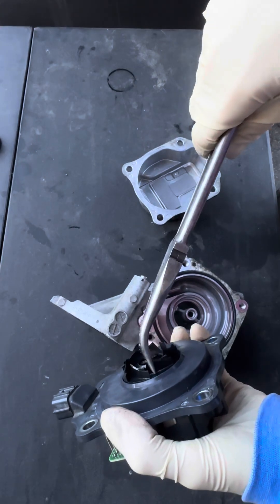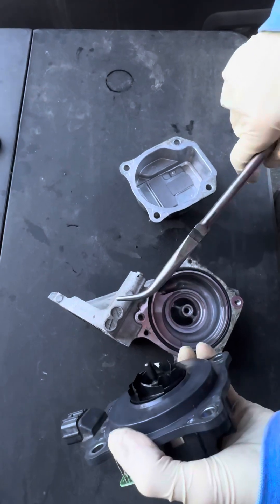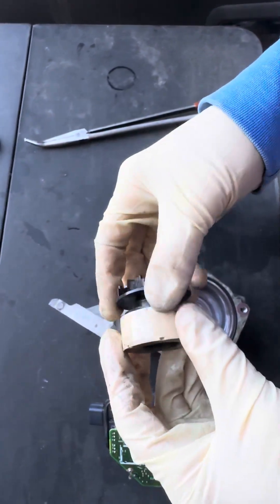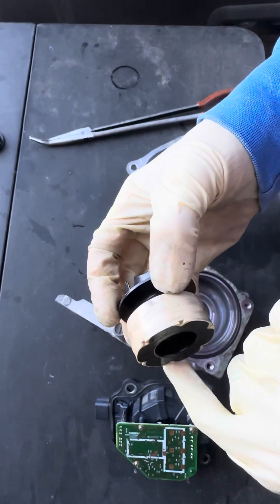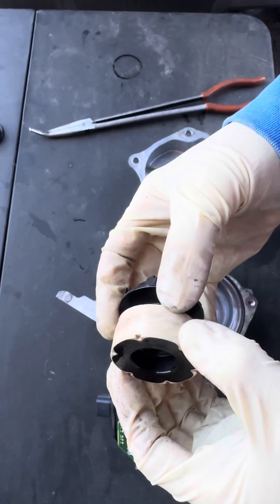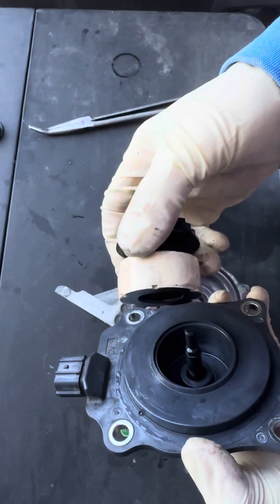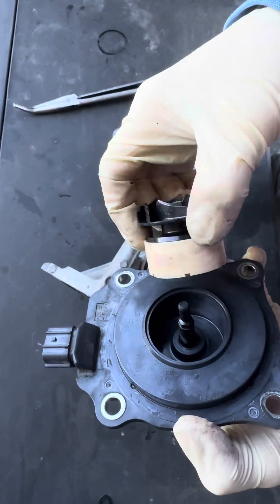It's got a magnet as well. This is basically the impeller that moves the water in this electric water pump, made by AISIN, which is Japanese. There's a magnet and basically a copper winding. This copper winding reacts to the three-phase electric field and spins this rotor. It works similarly to an alternator, but without brushes — so we call it a brushless motor.